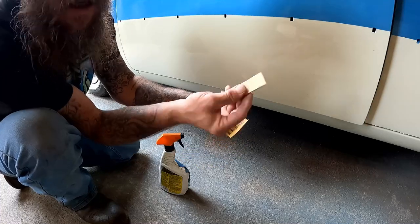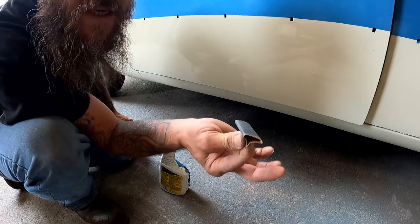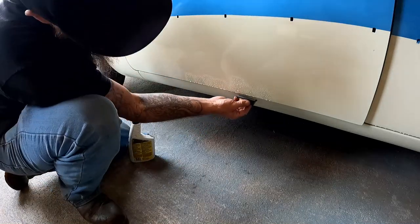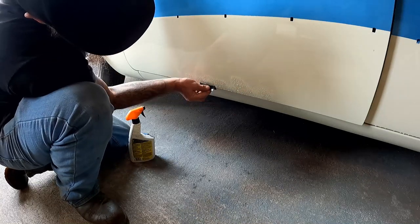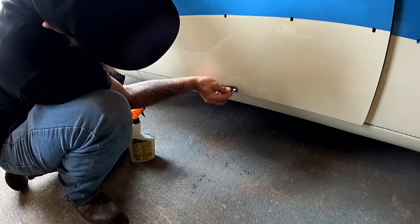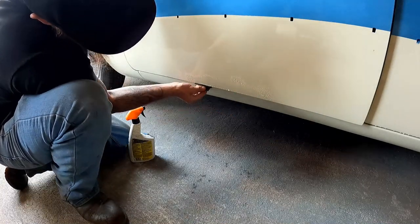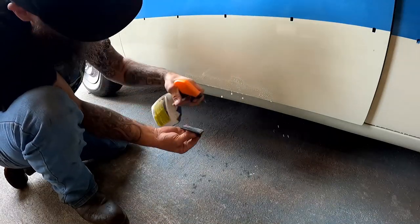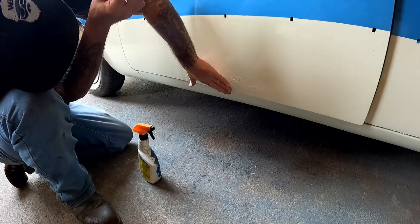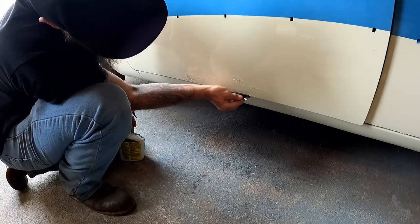This is just an old spray bottle full of soapy water. This is a piece of 1000-grit sandpaper and I've got a little piece of a paint stirring stick — I'm just going to wrap the sandpaper over that so I can pinch it together. We want to get our soapy water on there and hose all of this down real good. Be really careful on your edges — you will burn right through an edge if you're not careful. That's why we're using 1000 grit — we don't want anything super aggressive, it'll cut right through too fast. We obviously have plenty of material on here. Just come through there and keep sanding until it goes away — check it every once in a while. Round it over the edge and we ought to be okay.